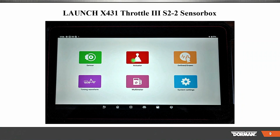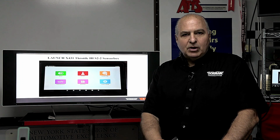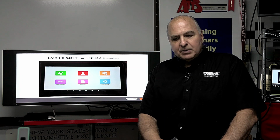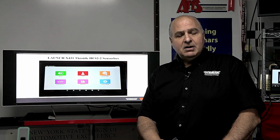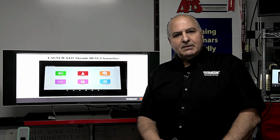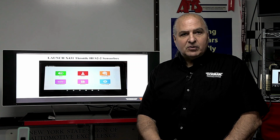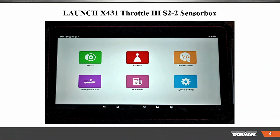The actuator, this is going to turn on all the different actuators that you want, and you could use it. I'm going to show you. It's not going to have an idle speed type motor that we're going to use off a GM throttle body, okay? But I'm going to show you, we can run anything. We can run evap solenoids, fuel pumps that they don't have in there. You can just about run anything by controlling power and ground and the frequency. Frequency is the amount of time something happens in a second. And you could ask questions, obviously, as we're going through.